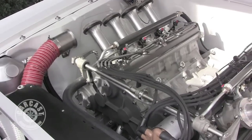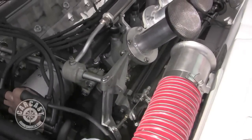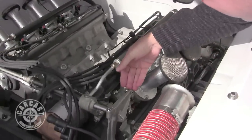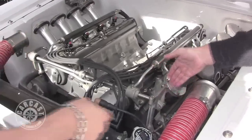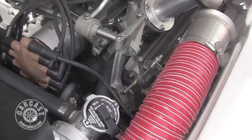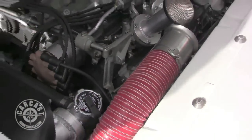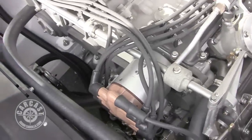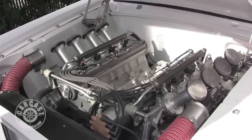Thank you for not using blue silicone tubing — I see it on vintage race cars. Get it in black if you want to run silicone. I want everything to look right from the day. This is one of the most exotic motors I've certainly ever seen in an American car — just incredible throttle linkage. It almost looks like a mini sway bar with end links. That's the Indy car stuff. We made all the bracketry to mount all the cable and had to slow it down at the throttle pedal inside, working with the lengths of the arms — that's idle and that's wide open. It's a crank trigger ignition. We converted it — there are no belts of any kind running off the front of this car because it's an Indy car motor.